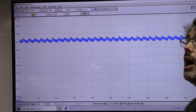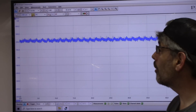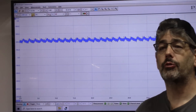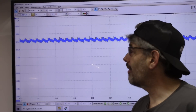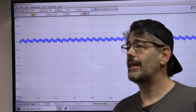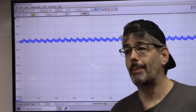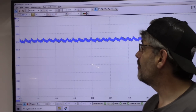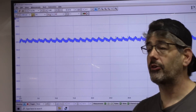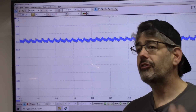We've had the car sitting overnight and we're going to put an amp clamp on there — you can use a DVOM too. Looking at our amperage from the battery, we can see evidence of a slight parasitic draw: 200 milliamps, which is definitely too much. I usually like to see as little as 10 milliamps on some cars, up to a maximum of 80 milliamps depending on the features and accessories. Under no circumstances would 200 milliamps be acceptable, so this explains the slow parasitic draw.